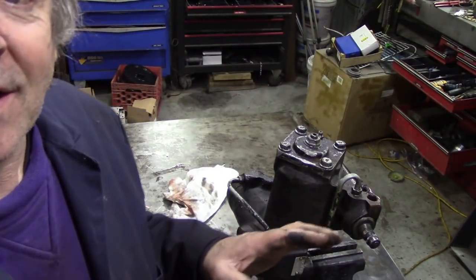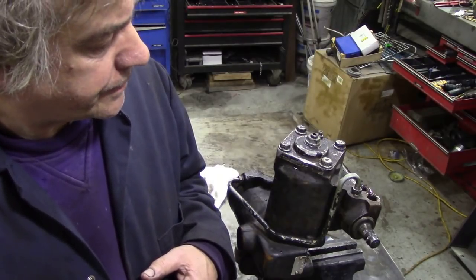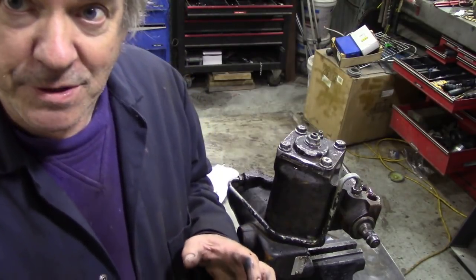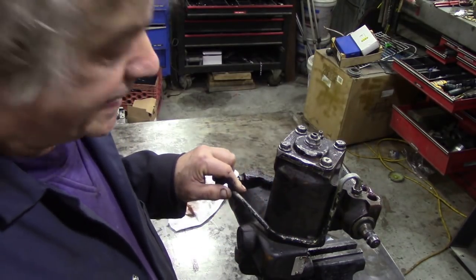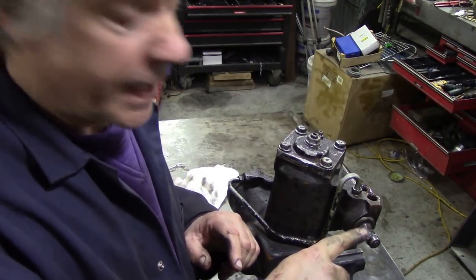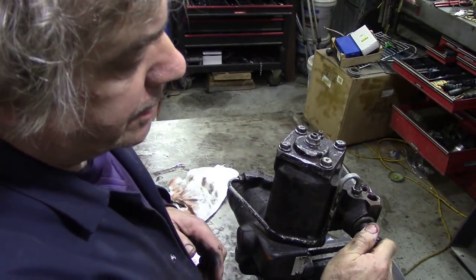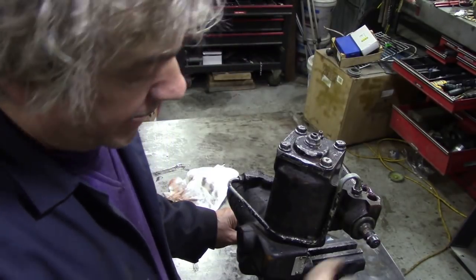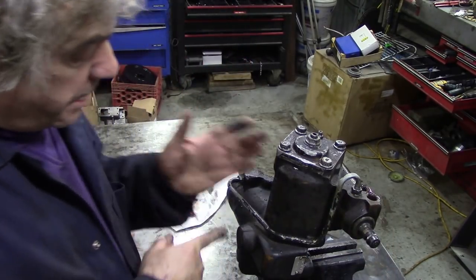It's kind of clever. This is called an Adwest lightweight. It is very similar to the manual steering box you find in army trucks and things like this. But what's different is you'll observe there's a pipe on the outside here. So what happens? This is not just an ordinary worm, no siree. This is the actual valve. Bear this in mind. So when you turn, and there's resistance on the drop arm, like on your wheels, it will slightly open the valve, put pressure in either side of a big piston that's in here.